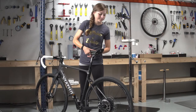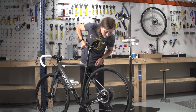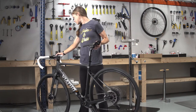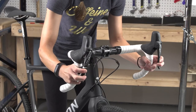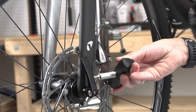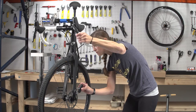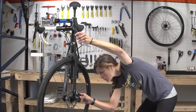Verify that the brakes are working properly. Lift the wheel off the ground and spin it. Look inside the caliper to see if the rotor is rubbing against the brake pad and listen for a rubbing sound. Check that the front and rear brake levers have the same amount of travel when applying the brakes. If the rotor is rubbing, loosen the brake caliper mounting bolts. Squeeze the brake lever and retighten the brake caliper mounting bolts. If there is still rubbing, it may be necessary to take it to a shop for adjustment.